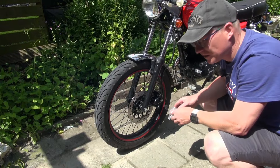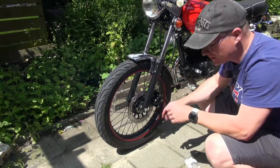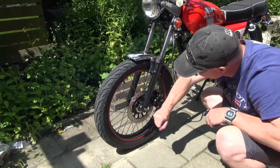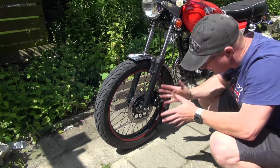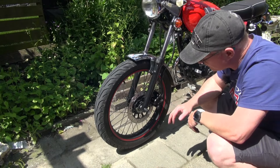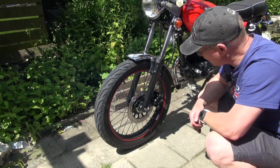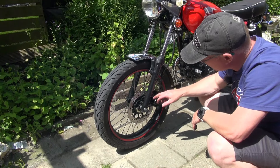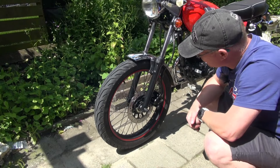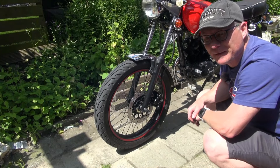One nice thing you can't complain about on these bikes: they have rubber caps on all bolt heads, both front and rear axle. I lost one and ordered a new one — two euros — and that gives me peace of mind. This is done. I'm going to ride about 100 kilometers, then check if everything is still torqued to spec, retighten if needed, and mark it off with a marker to note that I torqued them to spec. Now on to the rear axle — we're going to replace the rear bearings.